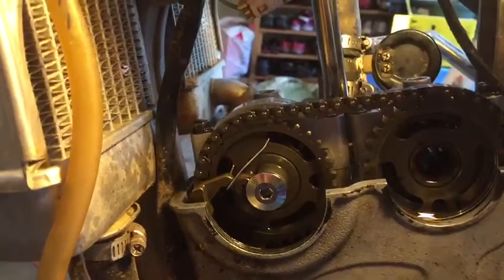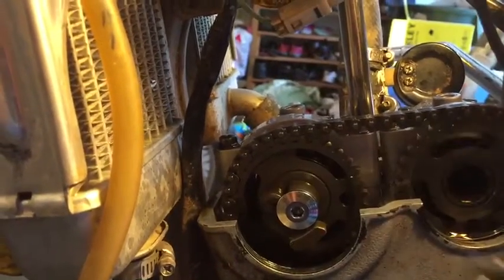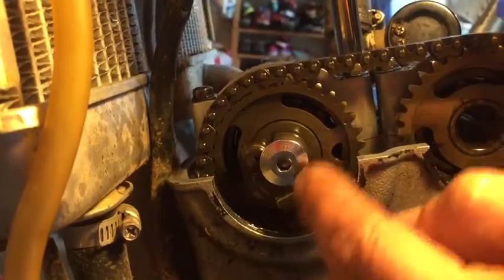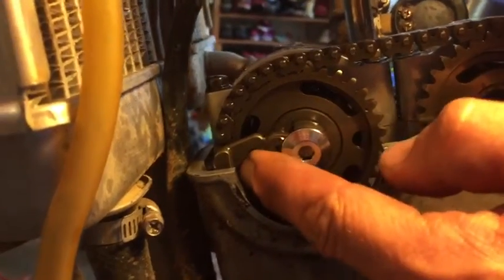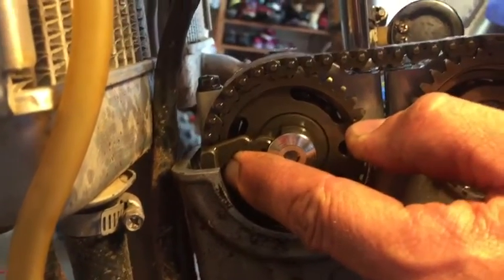What I'm going to do right now is pull it off so you can see how this thing actually works. I'm just going to pull off the wire, and now you can see — on a slow kick, it's going to be engaged. When the engine's running, this is disengaged. So all we did was manually disengage it for the purpose of getting a true compression reading.